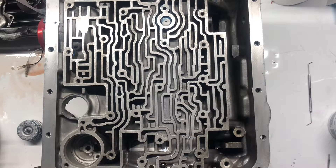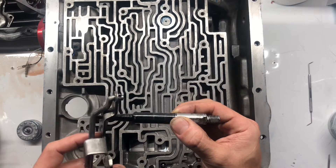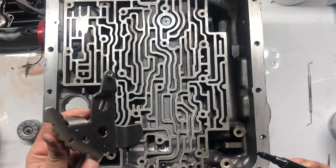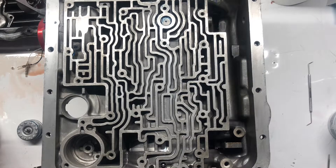This piece holds the selector in place and it also holds the neutral safety switch. So I've got this piece and this piece — this one goes through the case and holds this on. The other one is like the selector switch for inside the valve body. The neutral safety switch also connects to this. We'll dip them in a little transmission oil first since I just cleaned these off in my parts washer — just want to make sure they don't rust.